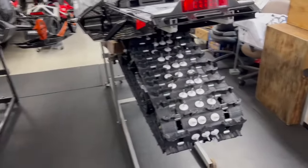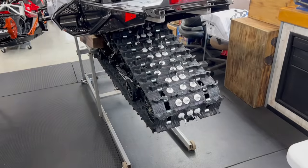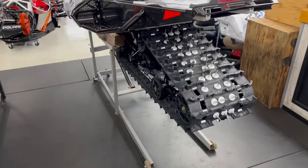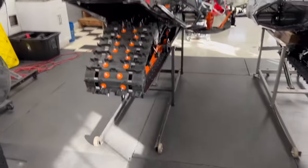Re-torque your studs after getting out into the cold — two-ply is 22 foot-pounds, one-ply is 30 foot-pounds. It's not rocket science: make sure your stuff is tight and torqued down, and make sure you've got the right stud for the right track. I seriously cannot thank Woody's enough for everything they do — they've been above and beyond since we started the channel. That'll do it for this video; make sure to like and subscribe, and we'll see you in the next one.